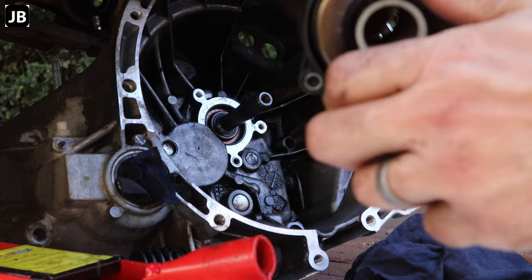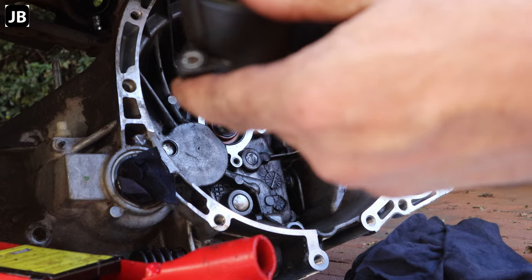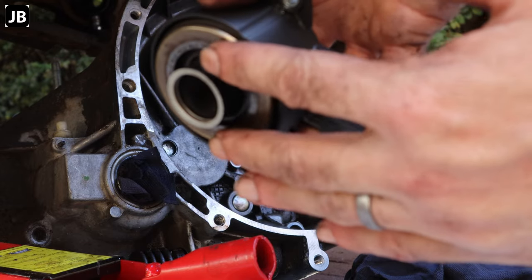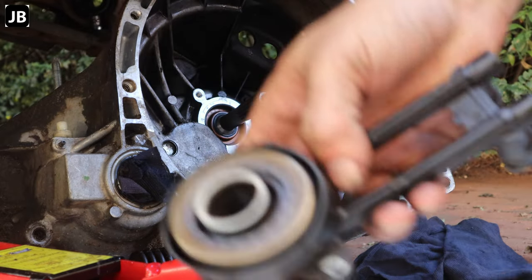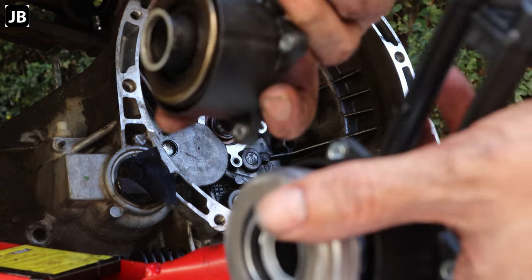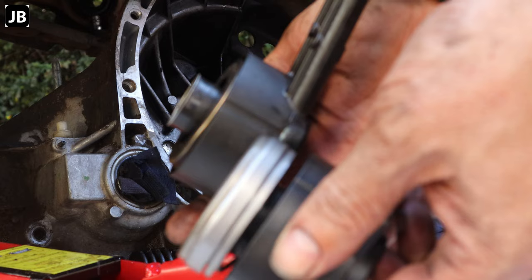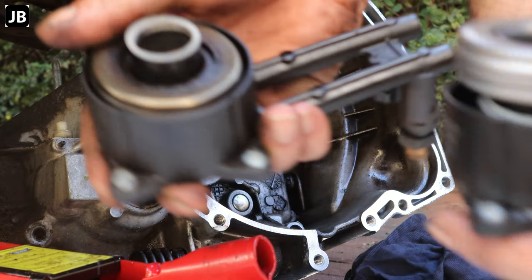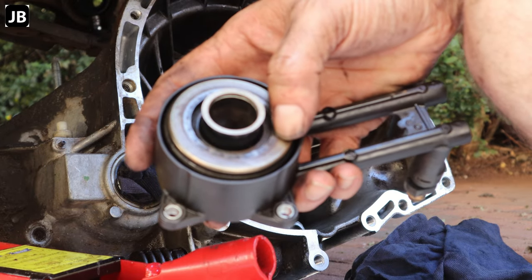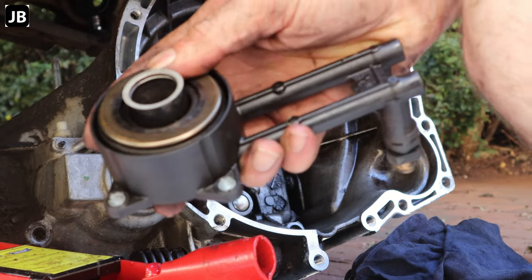Well, okay, so the release bearing's gone. Now it's totally frozen up. So that's definitely the problem, and it's leaking. Let me get the new one. Okay, so this is the old one, this is how I took it out. Release bearing, throwout bearing completely seized. This is what it should look like. So I can definitely say that's our problem. Junk. There you can see how the pressure plate dug into this top section during the last 300,000 kilometers. So good time to replace it.